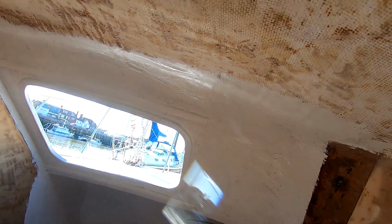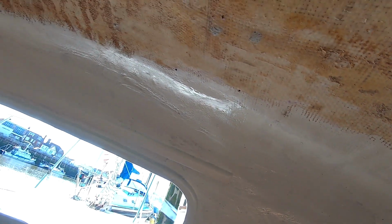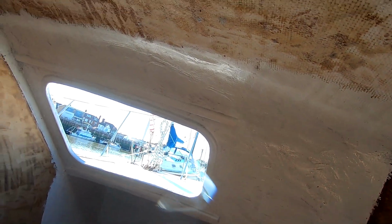And then come down tomorrow morning and do the final prep again. Get another coat on. But it's on. There's something on there. I can highlight any holes and stuff here that are going to need filling. And there's bits that I can look at later on tonight. Bits I need to sand, bits I need to build. Bits need to get right, just do the second coat of primer, and then hopefully from there it'll be somewhere close to the mark for me to apply the top coat.